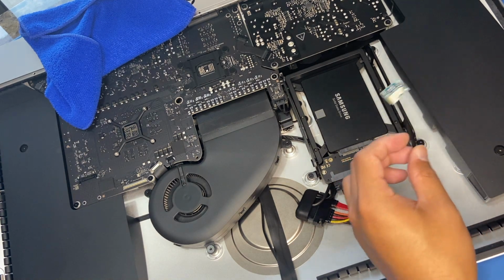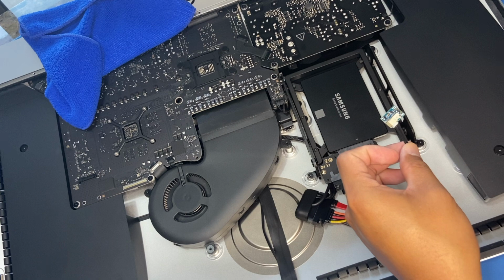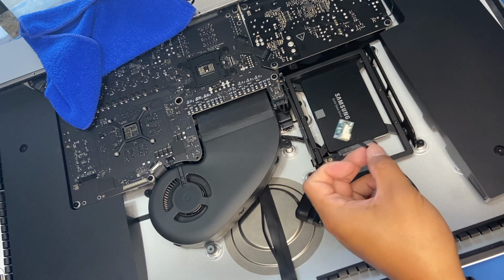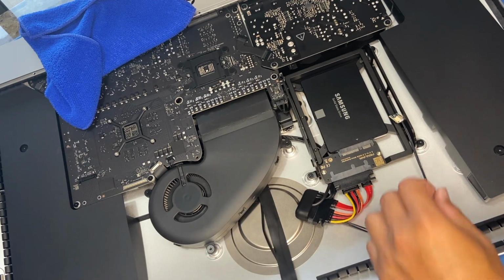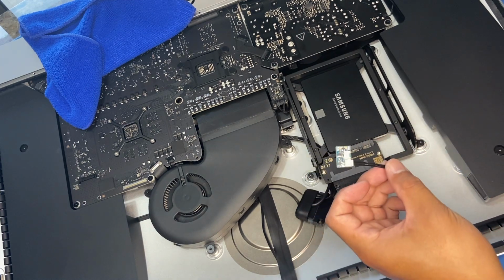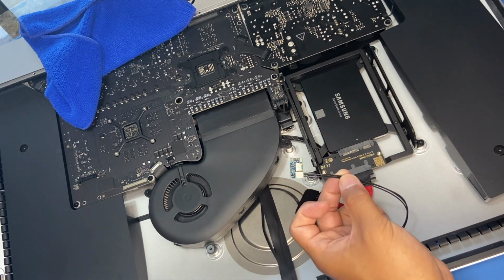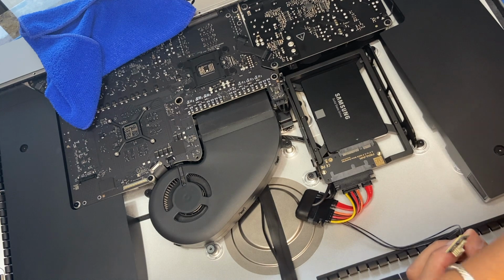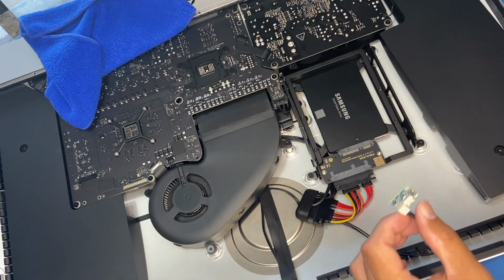The reason for this thermal sensor is that without it, your fan is just going to continuously rev up to high. If it doesn't have the sensor, it's just going to think that the drive is getting hot, so your fan life is going to drastically die early, or you'll just hear a lot of fan noise all the time. But there's a way of doing that by putting some program and software for fan control, but for everyday users, that's not really very feasible.